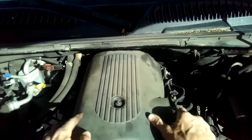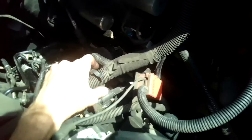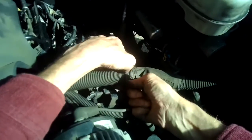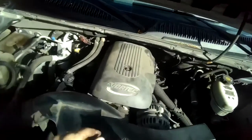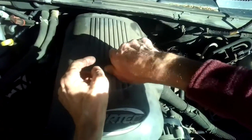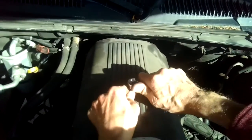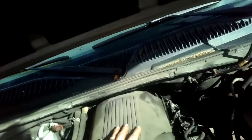And yeah, a lot of times a fuel injector cleaner system will do that. It's easy to do this procedure, it's not a big deal, but the injectors are really expensive. If you ever find any that are cheaper, like way cheaper, like you can get 8 of them for $50, it could be that it is a forgery coming in from China, and they probably won't function very well. So I'm just tightening up that 8 millimeter. And this car is from 2004, still running good, just had kind of a rough idle problem, and then it showed that cylinder number 3 was misfiring due to an injector problem. All right, we'll go and close it up.